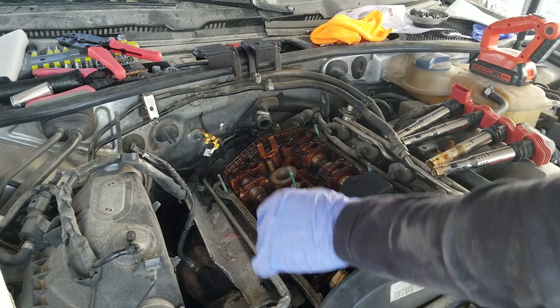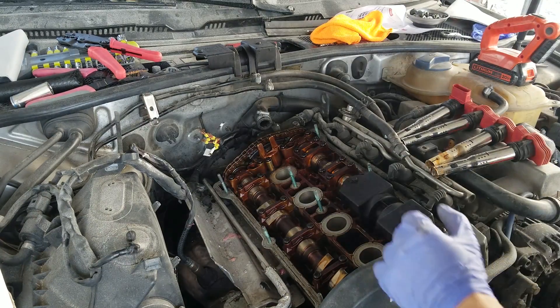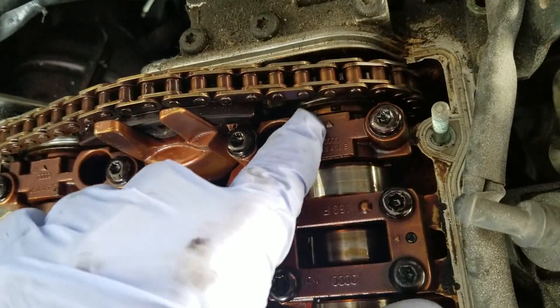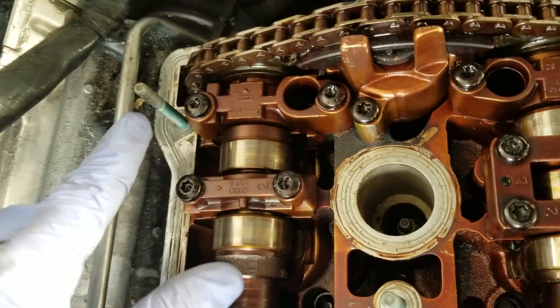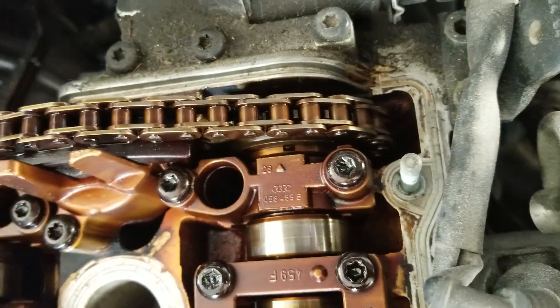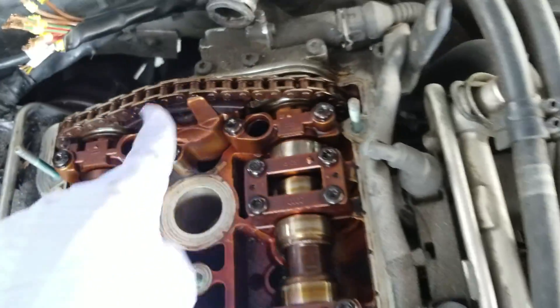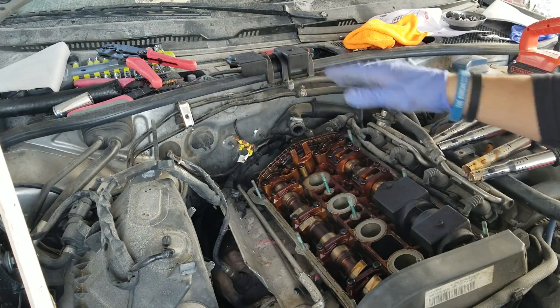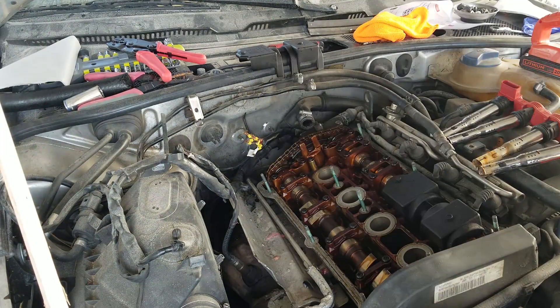I used a wrench to rotate the engine to what I believe is top dead center. There are two marks right up here in the gear — you can see that mark there and that one there, and then there are arrows here that point to those marks. From what I've seen online they don't always line up perfectly, but as long as you have 16 links from camshaft to camshaft you should be good. I'm going to count those to make sure and then we will install our tensioning tool. Get the gaskets back here — it's super tight so it should be really frustrating, but we're going to do it for peace of mind and to keep this engine from leaking anymore.